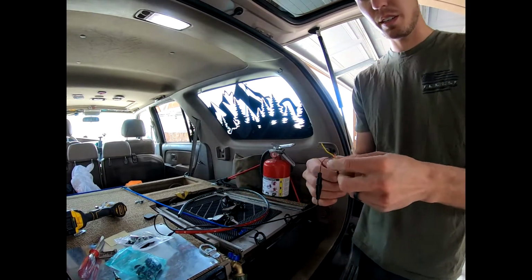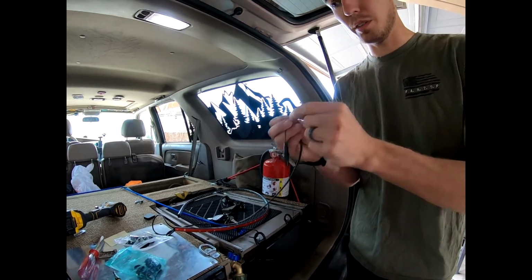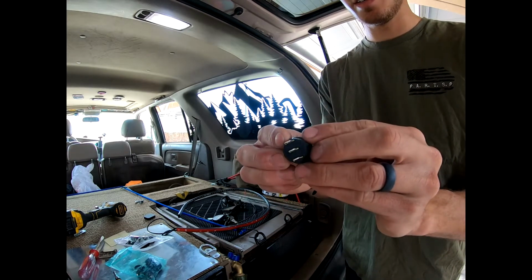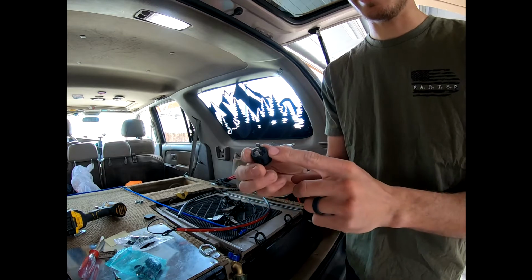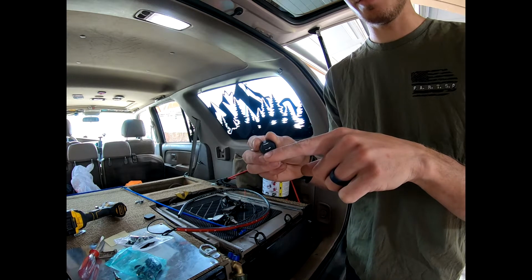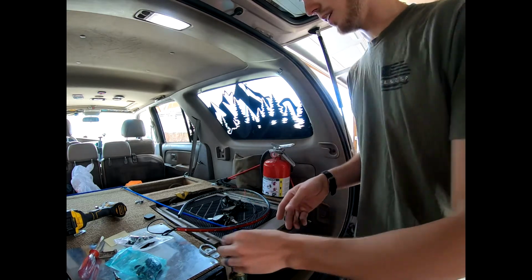Okay, so like I was saying, red, remember, is my white, and yellow is my amber. This is my ground. The red wire on these 2 little dots is going into this red, which fires up the white. Amber just goes to the black wire. The switch that I used is called a 3-pole switch. You've got an off in the middle, 1 and a 2. So how I have this wired up inside of my little panel, that I'll show you in a few minutes, is the positive comes into the center, and then I have a white wire coming out, and a yellow or amber wire coming out. It just depends on which circuit continues on. Does that make sense?